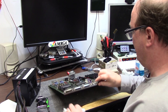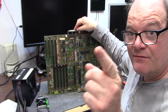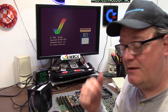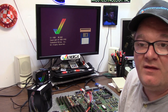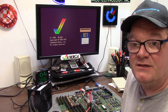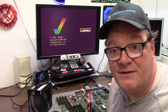I had to remove the composite video — it was destroyed, cracked in half, and wouldn't come out of the case. The serial port has a little bit of boogering on the bottom where it's squished down. I did remember to set J300 back to internal tick for your power supply so you don't have to worry about that. So that is Kevin's Amiga board and his Raspberry Pi — it needed a header, and we recapped this board, changed the CPU socket, and I'm going to write another ROM and put it back in. Sound, CIAs, battery-backed-up clock, and Zorro — all working and functional. Thanks for watching; I hope this was helpful. Thank you to my patrons and supporters who make these free repairs possible.